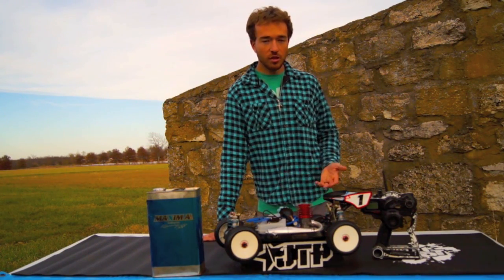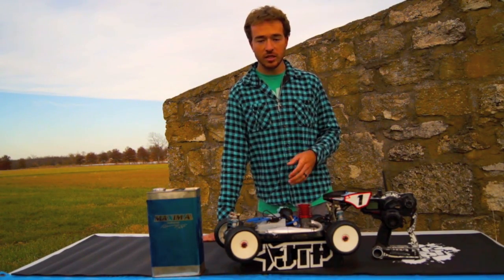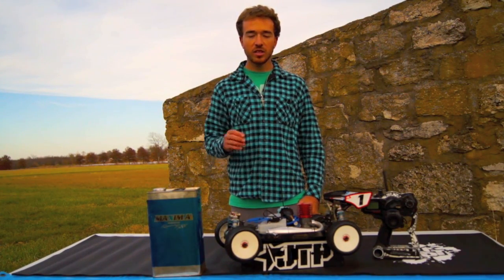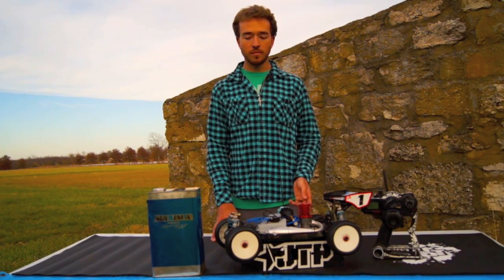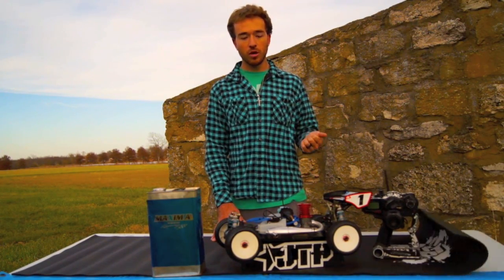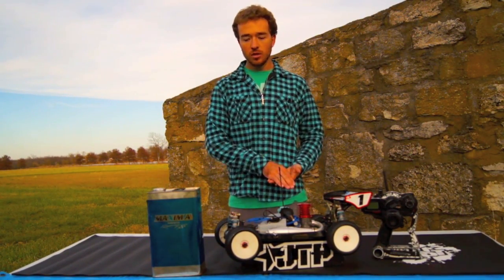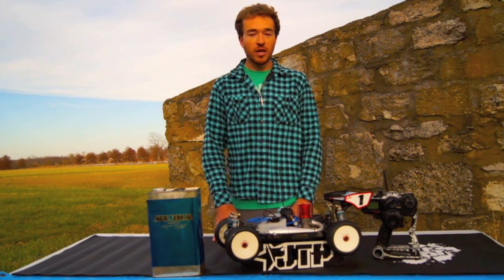Once you get that good, another technique that I like to use — once all that is good and you're liking the way it's sounding — is the 10-second rule. What that is: I'll clean it out again through low RPMs all the way up to the high RPMs. Once I get to the highest RPM, I'll just drop it back to neutral and count to 10. When I get to 10, you're not going to roll on — you're just going to go from neutral to full throttle. And you really want it to not lag, not load up, not puff smoke — just a real fresh rev through all the RPMs with a consistent smoke stream. When that's good, you're ready to hit the track.